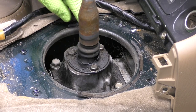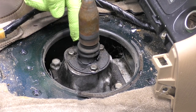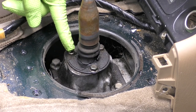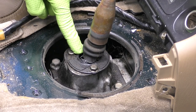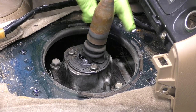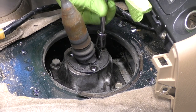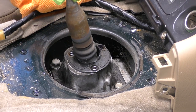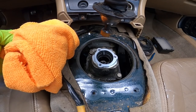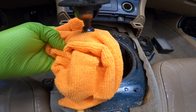Next, let's go ahead and get the shifter out of here. You'll notice there's a pretty good amount of dirt and grime on here. We need to be careful — we don't want to get any of this inside our transmission turret. We don't really want to go spraying and wiping it because we're going to just end up wiping it right into here. If your gasket's not split, clean this now. If this rubber piece is split like mine, we'll clean it up afterwards. Three 10 millimeter bolts, and this should come right out. Go ahead and get a rag. We're just going to lift this straight up and out. You may get some drips of transmission fluid — that's what you want the rag for. Put it in the rag and then take it to the bench.